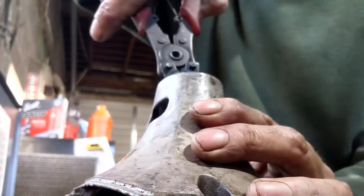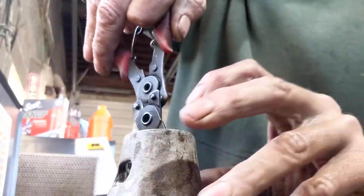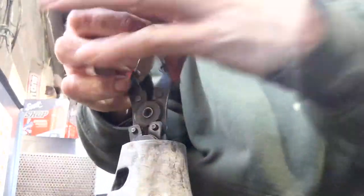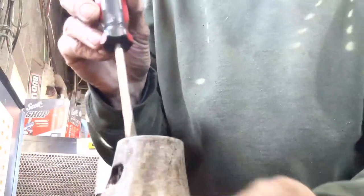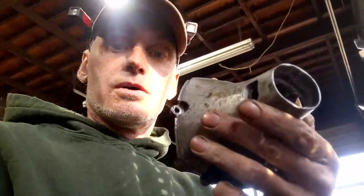And then we're going to lower it down in there. If it doesn't come off of the pliers — because sometimes they get stuck on the pliers — just take a flathead to hold the snap ring down while you pull up. Then just kind of tap on it to make sure it seats in that line that I showed you. And there it is — you can see the snap ring in there, it's seated. And we are done. And that is how you change the clutch drum on a weed whacker.